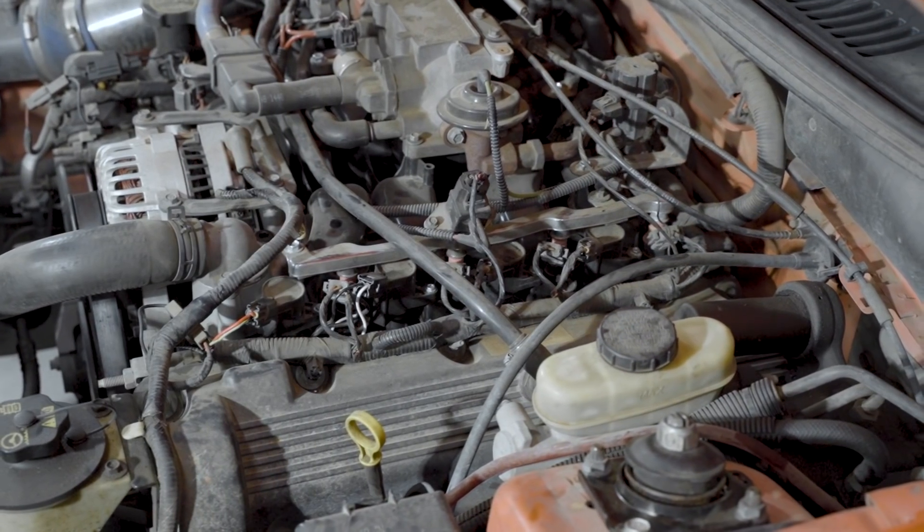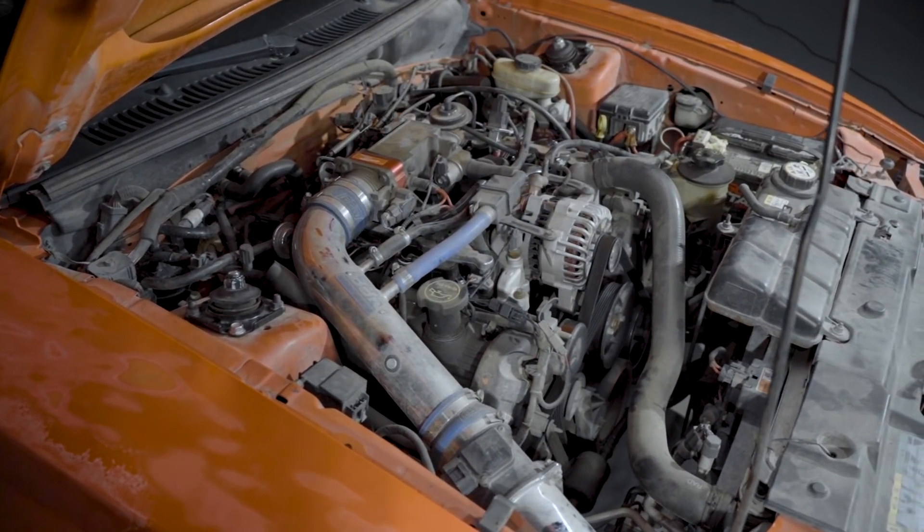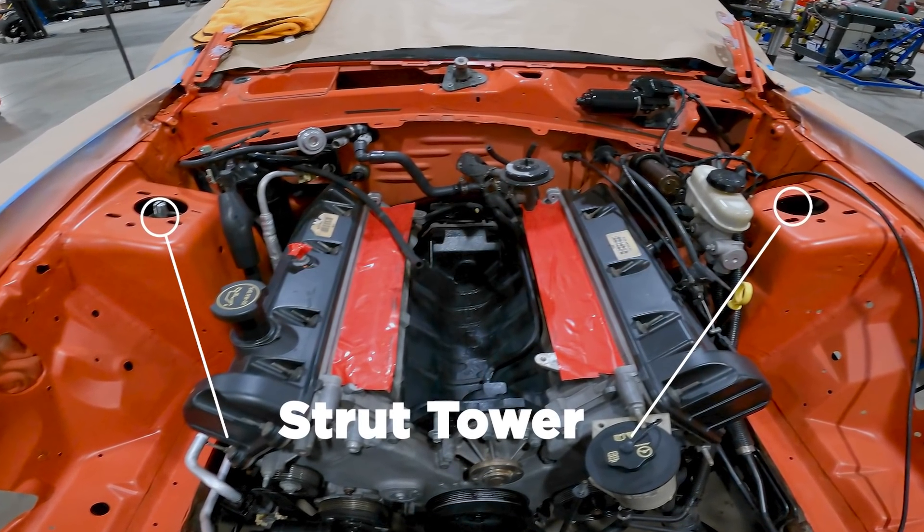The old two-valve we've seen a lot over the last 17 years. It definitely needs a good cleaning and probably a lot of parts replaced, so Landon's going to run through there and get it all cleaned up, address what needs to get changed, and it should look like a brand new motor once it's done. We lifted the car up with a jack, supported the frame rails with jack stands, lowered it down, removed the wheels, and removed the upper strut mount plates from the strut towers so we can hang the suspension.